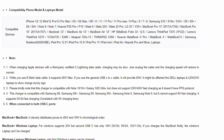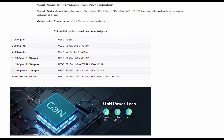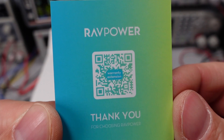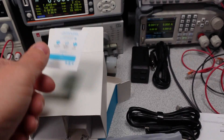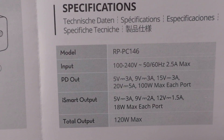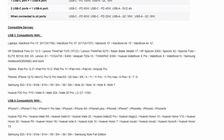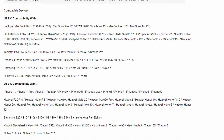They do explicitly state no programmable power supply mode or PPS mode, and the port sharing is also on the site, so you get an idea of what happens with multiple ports plugged in. The 120 watt adapter follows similar suit with a fairly detailed user manual and the webpage providing the bulk of the information — what devices it can charge and how the power is distributed between the ports. This is probably the most comprehensive listing I have seen, with the cans and cannot-do's listed right in plain text. The infographics are nice, but not enough sometimes.